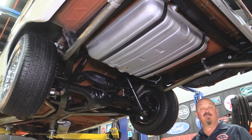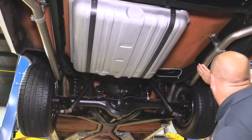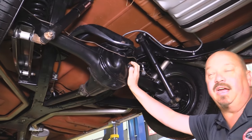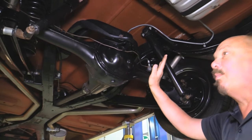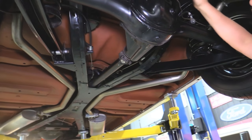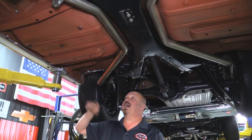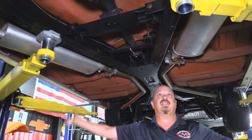We're underneath this '58 Bel Air now, and this baby's probably the nicest '58 Bel Air on the planet. As you can see — brand new gas tank, brand new exhaust, metal all looks original to the car. We've got primer, beautiful paint on the frame. Obviously this baby was off the frame. We've got a 335 gear in here, she is an open rear end. The date code says it's a '57 date code — more than likely this is the correct rear end. All the bushings look good. The guys pulled the brakes apart, they're all in good shape. Brake lines are new, all the bushings and the upper control arm look new. Back sides of the rockers look original to the car. All the body mounts look original to the car. New fuel line going front to back. The exhaust is tucked right up in there nice and neat. The mufflers are period correct. This thing is absolutely gorgeous.